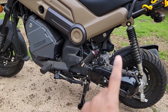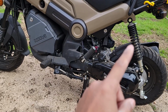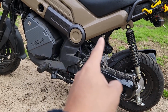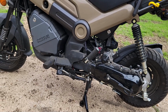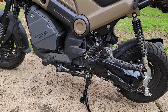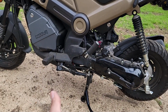Once it's on two wheels, the person helping you will be able to control how high this shock goes and lowers. So they should be handling the body, you know, have their hand somewhere around the rack or the undercarriage. Be careful, don't crack your plastics, please. And it'll help lower slowly, where you can just throw that bolt in. Good to go. So you're basically letting gravity do the work while having somebody control how fast gravity wants to bring your bike all the way to the floor.